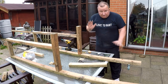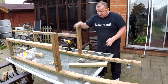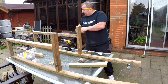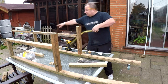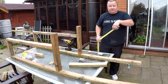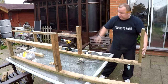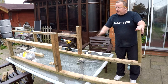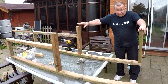As you can see at the moment, we've basically got our framework built up now either side, and then I've got to join these two together. I'm struggling because I haven't quite got the right size wood — I think these are about three by twos. The front of the van sits on the lower part, and from the end to when it steps up that is 46 inches overall to the outside. So the front run steps up at the back — it's 46 inches, then it goes up 7.5 inches, then along to the back 36 inches which is 3 foot. These are cut to length, sitting at the end like that, and then we need one piece to sit on the top and square up. Once you've done both sides, it's just a matter of joining the two together to make a sort of box section, and then I might throw the odd diagonal in.